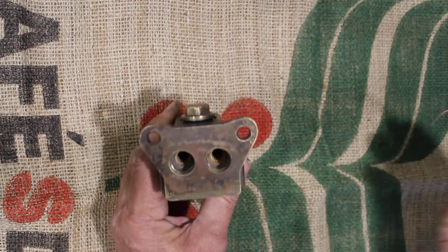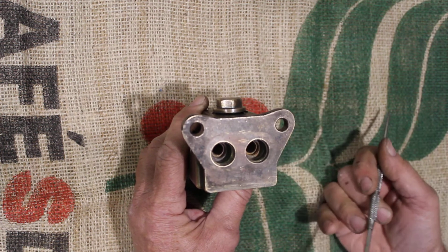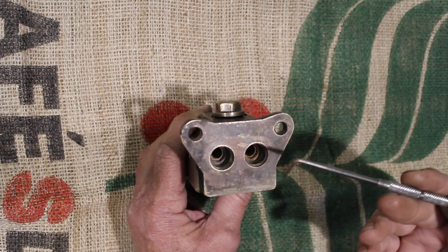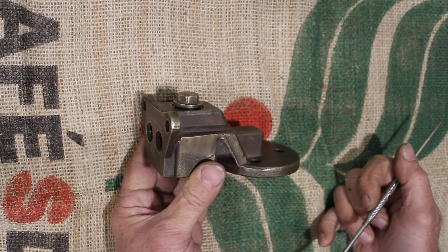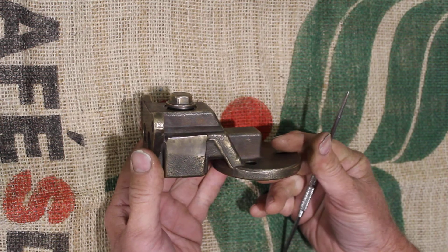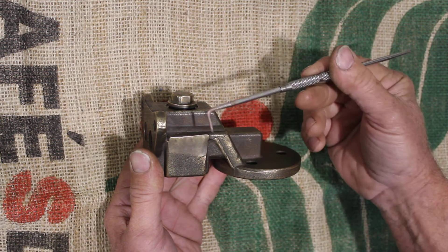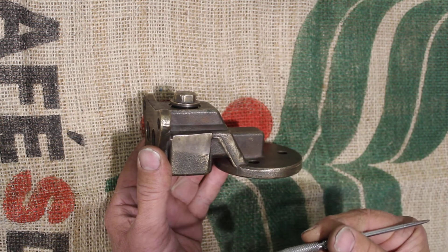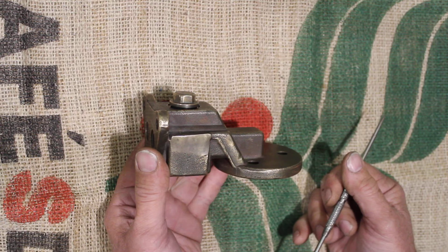Water normally flows in this pipe. It has a second pipe on this head which allows for the thermal siphon system to operate, which essentially carries heat up into this thermal mass and keeps it at the same temperature, hopefully, as the brew water. That is so that when you start to run a shot and water flows into this, the mass of metal here does not rob any temperature from the brew water coming out of the boiler. We want to keep those temperatures as stable as possible.